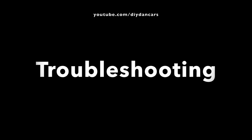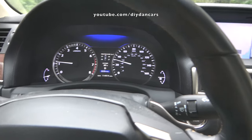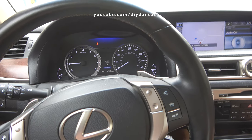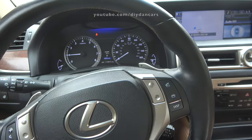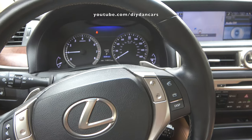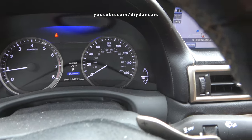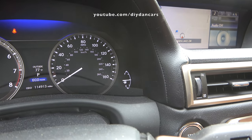Programming the new tire pressure sensors went very smoothly, but I understand not everyone will have the same luck. In this troubleshooting section, I'll give some tips if you're having problems getting the new sensors to register to the car's computer. If you just got done programming your TPMS sensors and had your tire shop install them, and you're still getting a blanked out screen, there are a couple things you could try. There's actually a reset button under the steering column — I'll show you what that button looks like. If you hold that button down while the car is running, that will reset the tire pressure monitoring system in the vehicle.